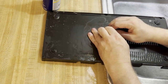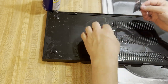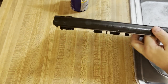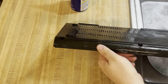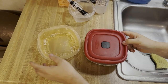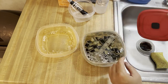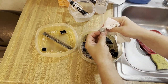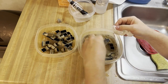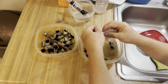Next comes the serial number badge on the back. I will remove that and tape it back on there once it's all done. You can see some of the little white spots here — usually I'm worried about black spots on a beige case, but it's kind of backwards here. Now with the keys: we let these keys soak in soapy water for a while. Now we can wipe them all off one at a time. We'll set the 7 key aside because it does not need retrobriting — the others do. So we'll use the 7 key as a control for this.